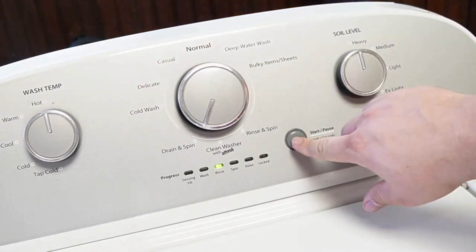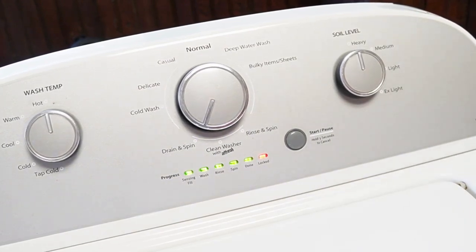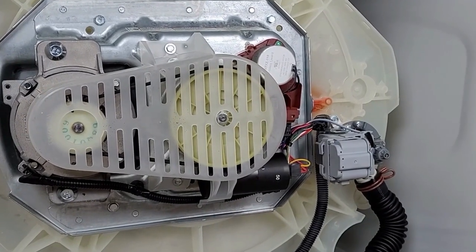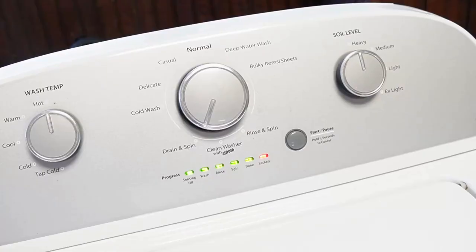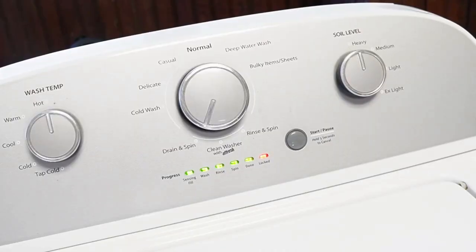Once you press the start button here on the rinse mode, the door lid will lock and it will begin a series of tests and operations on your washing machine. All these tests take approximately three minutes to run all the way through. As the recalibration mode runs, every part and process on this washing machine is going to be run and the machine will physically reset all the components to a default state, allowing them to run at an optimal level. This is a must-have when parts aren't working right or the machine just doesn't know what state it's actually in, like you've replaced the shift actuator or even a control board. During this time, you're going to hear all kinds of noises from the machine and that's totally normal. When the calibration mode is at the end, every single light is going to turn off, including the lid lock light, and the machine is now ready and recalibrated for use at an optimal level.